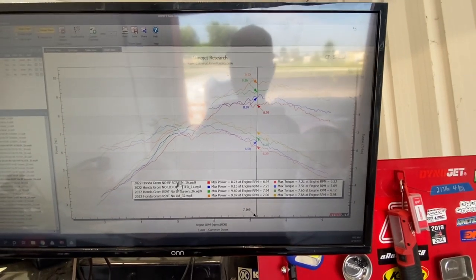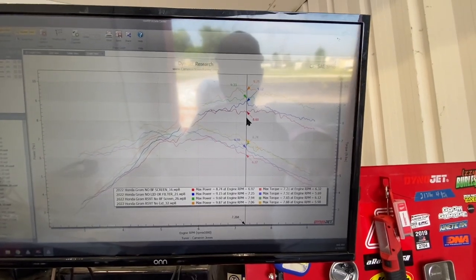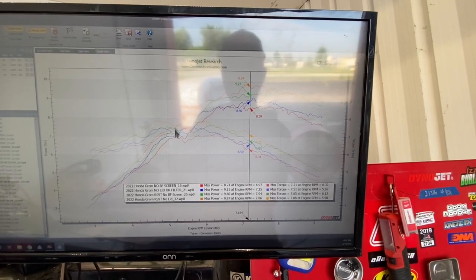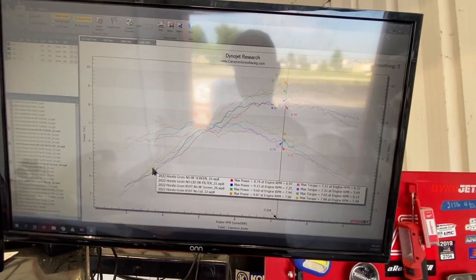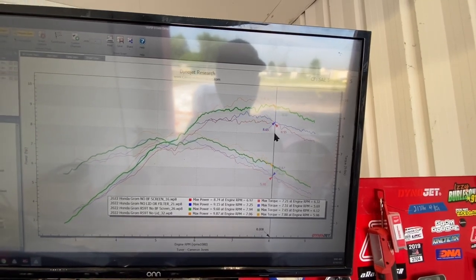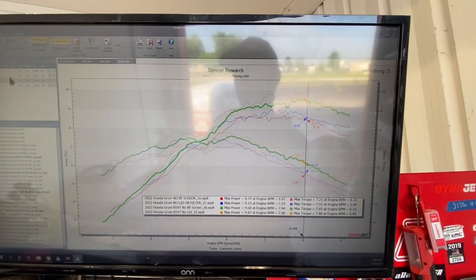So with this as a breakdown, bone stock we have a red line at 8.74, kind of seeing that 8.6 once you start dragging it across quite a bit. Our blue line at 9.15, which is on that little peak there, but as soon as you go 100 RPM before or after, you're right at that nine horse. Looking at adding the RS9T — we bumped up to this green line and picked up some low end, actually lost some low end, everything under 3,000 from 4,000 up. So picking up through the mid-range, and definitely a good top end gain. Looks like we're going from like an 8.6 to a 9.5, so almost a horse — that's about almost 10%, maybe right at 10%. And went ahead and pulled the lid off just for a quick pass.